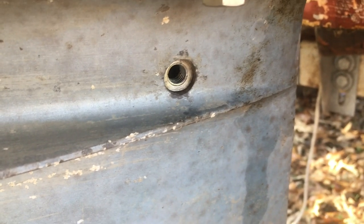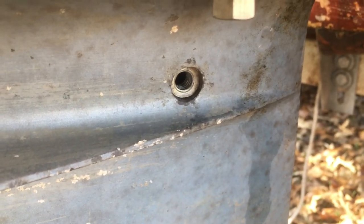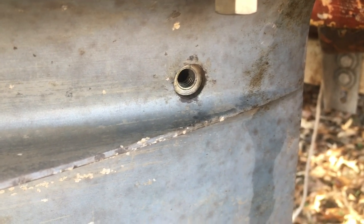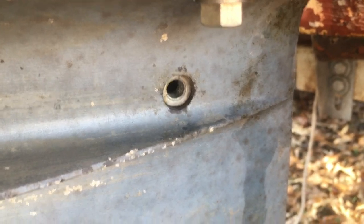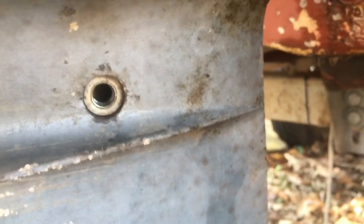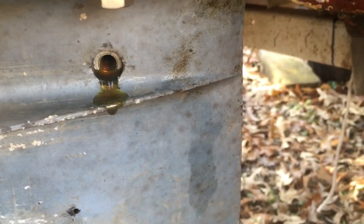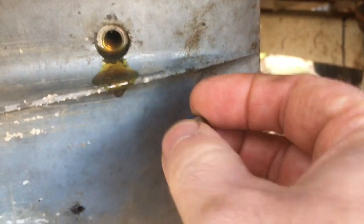The reason you pump from the bottom instead of filling from the top is to avoid any air pockets or air bubbles. I don't know exactly what the passageways look like inside the lower unit, but everything I've heard says that's why you fill from the bottom — to make sure you get all the air out. After a few hundred pumps, you can see oil starting to come out of the top hole. We do a couple more pumps and there's more oil coming out, so it's all the way filled up. Now we put the plug back in the top and make sure it's completely tight.